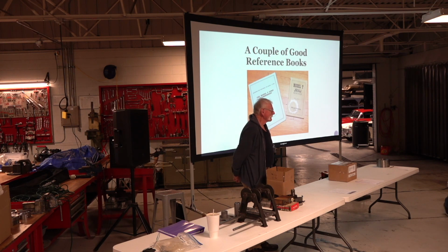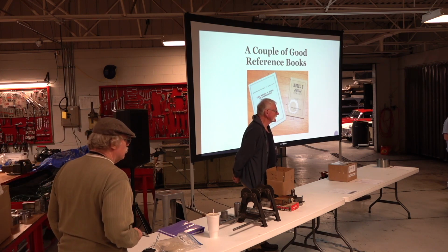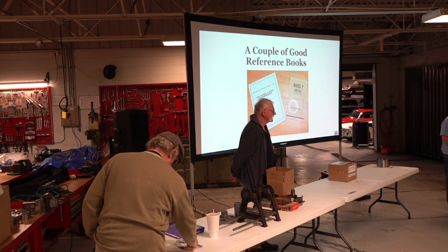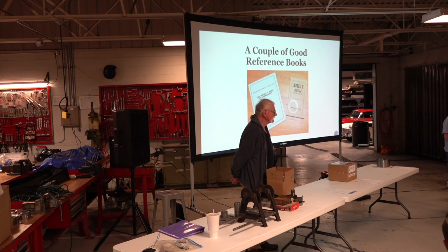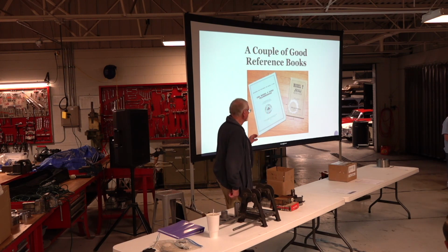Well, what we have done, and I don't necessarily recommend it, but it works good, was to take the whole bolt out and smooth off around the edges. Put the bolt in upside down, the lock nut on top, and then you have more bolt that covers that shoe and covers that area it's worn. Yeah, I think that might work.